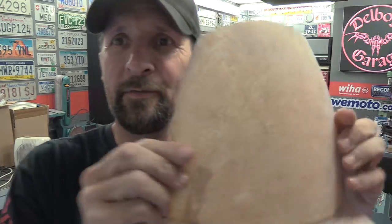There we are, story so far. At three layers thick of fully saturated fiberglass, this thing was about 4 millimeters thick in places. And because I'd layered it up with resin to make it really, really saturated and wet, it was quite wobbly and knobbly on the front. And the initial thought was to just fill all that with filler, big skin over it, and then sand it flat, but it would have just made it heavy.